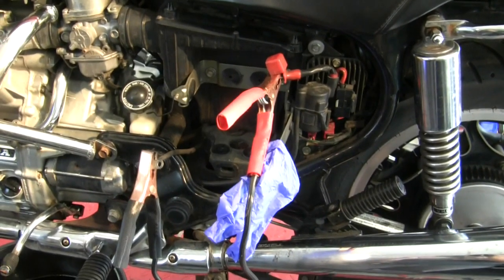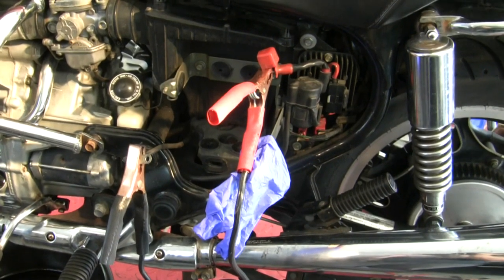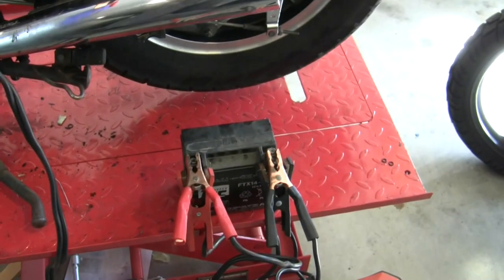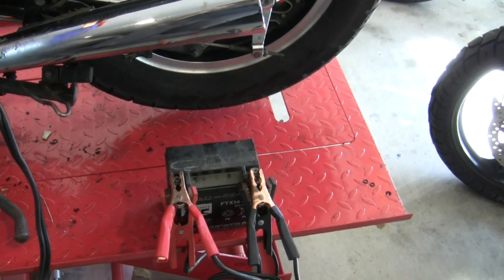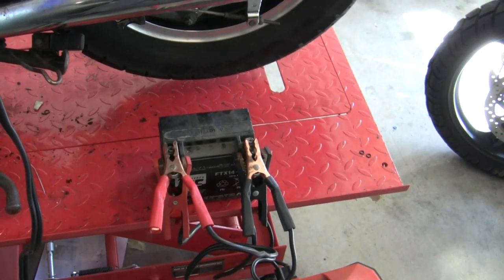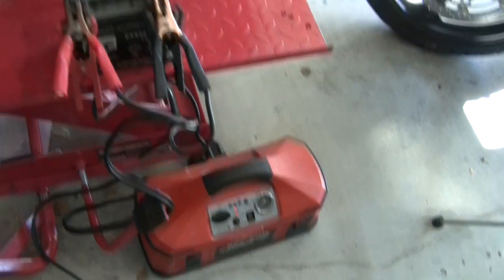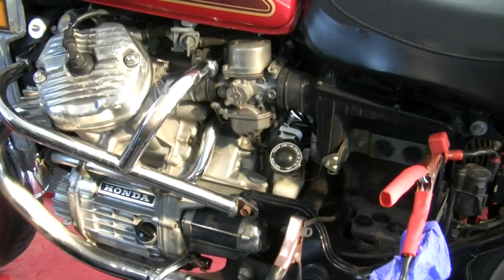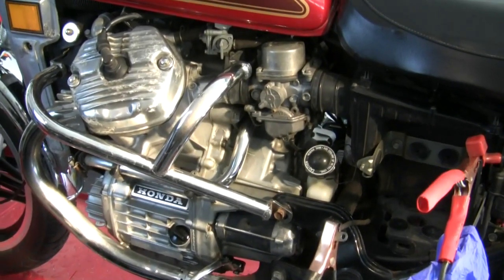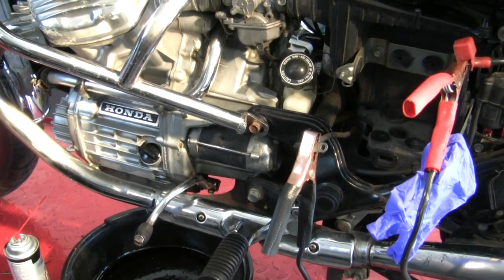Dead battery, obviously, with this bike. Pulled the dead battery out. I have some jumper cables hooked up to the battery terminals. Those cables go to a different-sized motorcycle battery that is okay, not great. So I've got another set of alligator clips going from there in parallel down to an emergency jumper battery. Between the two of these, I'm probably simulating a good battery. I don't think I'm going to get this thing started, but I would like to turn it over and just see if the starter really turns fast or maybe I've got a starter issue that needs to be addressed.